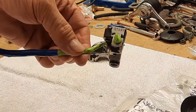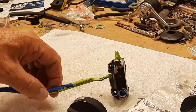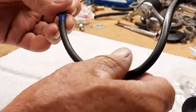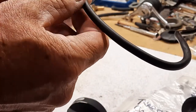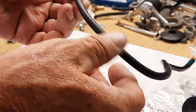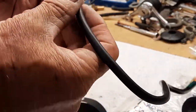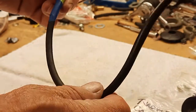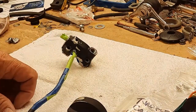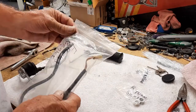So I've got these taped off, and we're going to paint these. And what I did too here, this was bubbled also, just really bubbled and hard. I mean, almost like 60 grit sandpaper. And what I did was I took 800 sandpaper and I sanded it, and it's really helped. I mean, it looks beautiful. So I think I'm going to get these looking super sharp. So let's get it painted. While that paint's drying, I've got about 10 minutes in between coats.